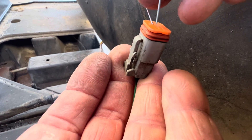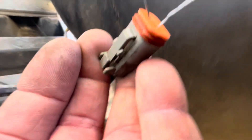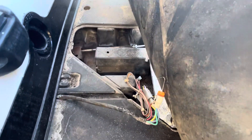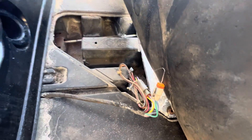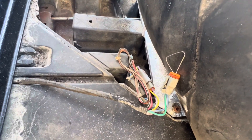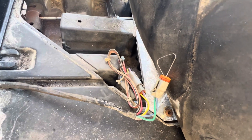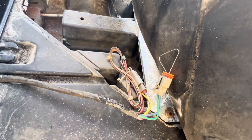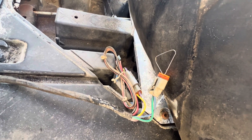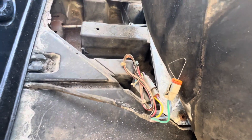Take it like this and just hook the two wires together. Now the way it works: the solenoid would not engage until it gets an ohm reading from the potentiometer. So even though you've got a bypass, the car still won't run until it gets a potentiometer reading — it's pretty much for safety. If the gas pedal sticks down, it'll shut the car off, or trigger a high pedal disabled fault which shuts the car off from taking off. Stay tuned, I appreciate you watching.